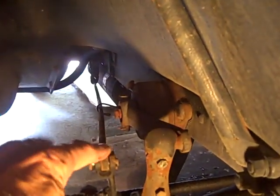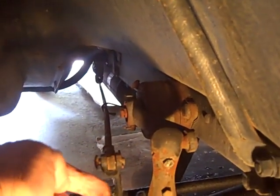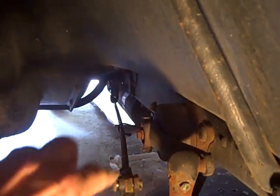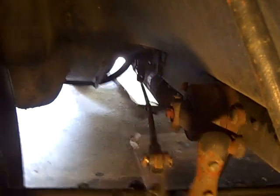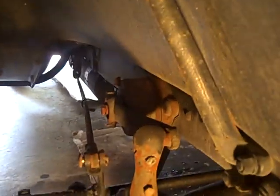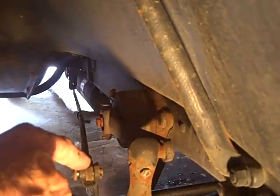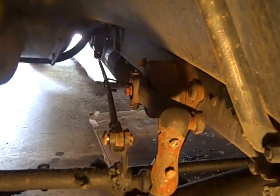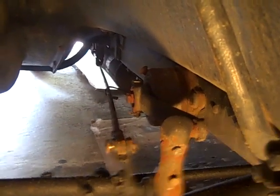Now this is the lever that should be slanted toward me a few degrees, and when you push on the pedal, that pulls that rearward, and that rotates a shaft in here, and that pushes a pin down, and at the bottom of that pin is where the pill goes. But you want this lever pointing a little bit toward the front of the car so that it has a good bite. When you push on the brake pedal, it will apply the brakes better.